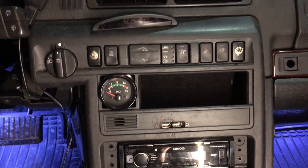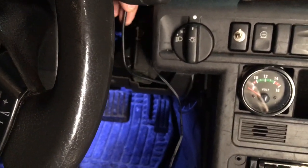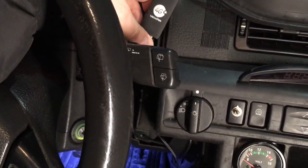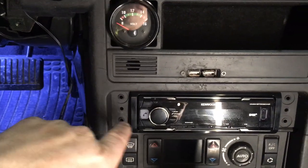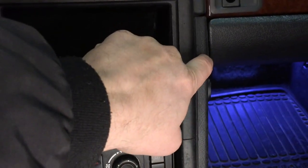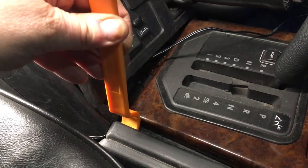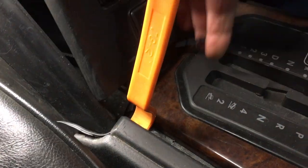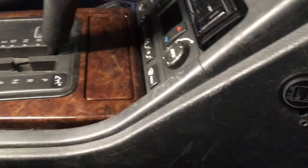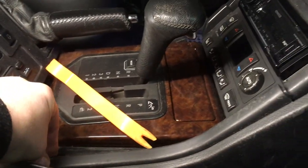To remove the center piece — this whole trim — there's one screw down here, already removed. There's also the 4G USB modem for my Wi-Fi access, which I'll fix the cabling for as well. You remove these two screws here, already done, and then there's one screw here and another screw behind this trim piece. I'm putting in one of these plastic pry bars on the end to separate it, moving the power cable off the door, pushing it out, and at the same time sliding it down and pulling it out. I'm pulling on the edge and pushing down — and it let go here.